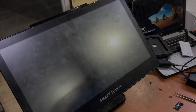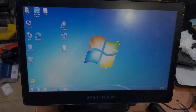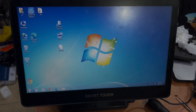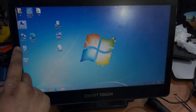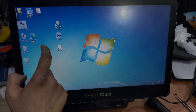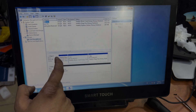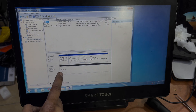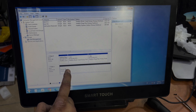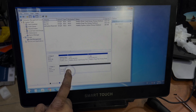The hard disk is assembled now. I will turn it on and check if the hard disk is detected. We turned it back on — right-click on My Computer, then go to Manage, then Disk Management. You can see this hard disk is 120 GB SSD. It is unallocated and needs a partition. We will make a partition and then it is ready to use.